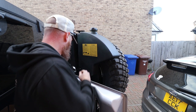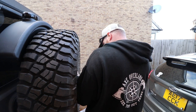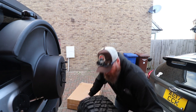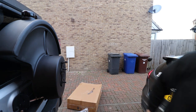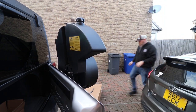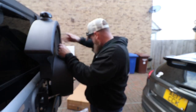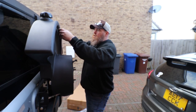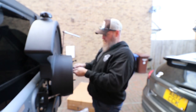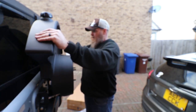Might take a while. All right, so now take his tire back off and then adjust that last bolt on top. All right. Pretty sure that's a 5/8. You'll grab that. All right, so like I said, this just puts a little tension on this bracket out here, to keep it from going up and down. Definitely want to make sure you do that, because a 35-inch tire's got some oomph to it.